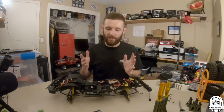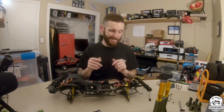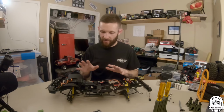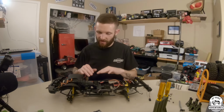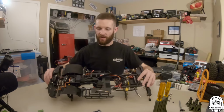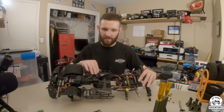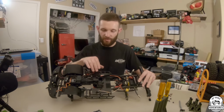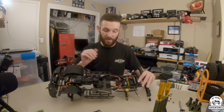Well, guys, that looks like that's about as much as I'm actually going to get done on video tonight. I've got a few things I've got to figure out with the wiring, figure out how exactly I want to lay it out and get it nice and clean. I did a last minute change on how my cable ties here are functioning. Instead of using an angled mount that puts them up next to the side of the transmission, I ended up using mounts on the chassis and doing a lay flat on this plate.